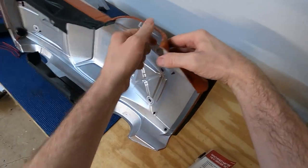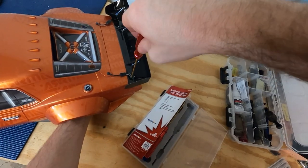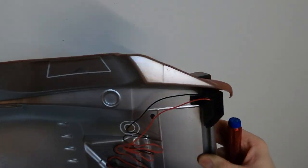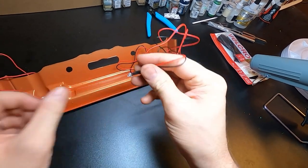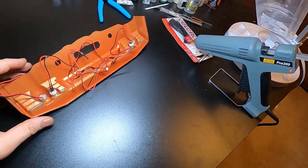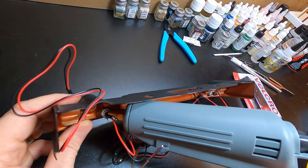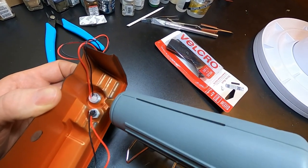To put the rear tail lights on, it's actually pretty easy — we're going to take off the rear spoiler. The rear tail lights go like that. I'm going to get some longer screws for that; I'm not going to do it today. These little lights right here go down inside of there but don't really stick or hold or anything, so what we're going to do is put some hot glue down there and see if we can get it to stay. Try not to touch the wire with the heating element, and try to straighten them up as it cools.